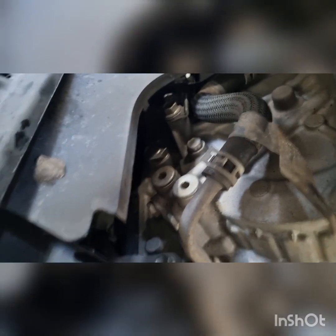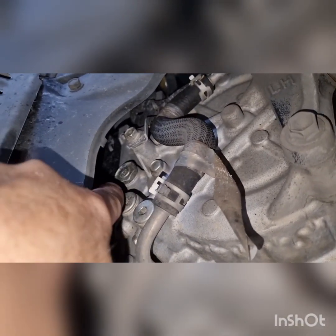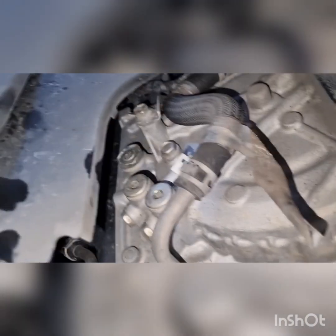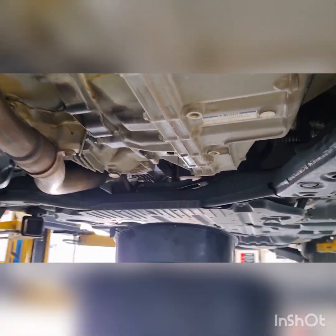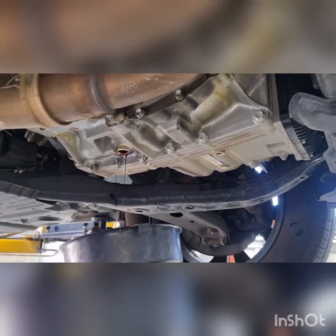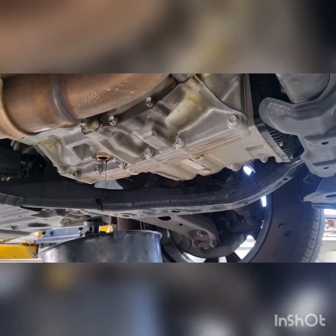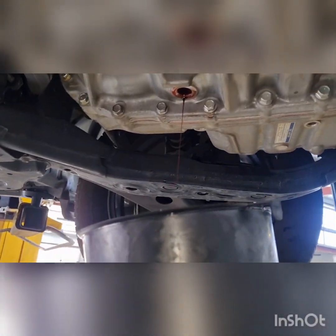And it is that 24mm — right there — it's got 'WS' on the side of the plug. When you see that, that stands for World Standard Oil, so in our case we are going to use a fully synthetic automatic transmission oil. We buy ours from DriveLine over here in WA and it's called LubeGuard Fully Synthetic Automatic Transmission Fluid.